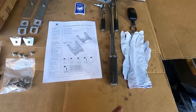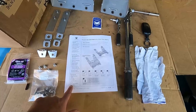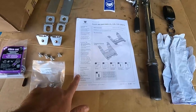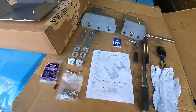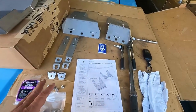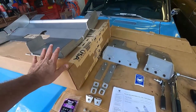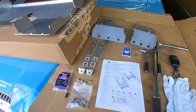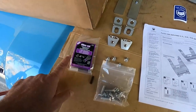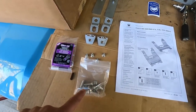You will need some protective gloves and eyewear. We're also going to need a 15-millimeter deep socket, a bit driver, ratchet with an extension, and a torque wrench. An 8-millimeter socket is only required if you have the splash shield — this truck does not have it. If you do have that splash shield underneath, you'll need to remove it first using those four 8-millimeter bolts, then put it back when done. It is important that you apply the included thread locker to all fasteners.